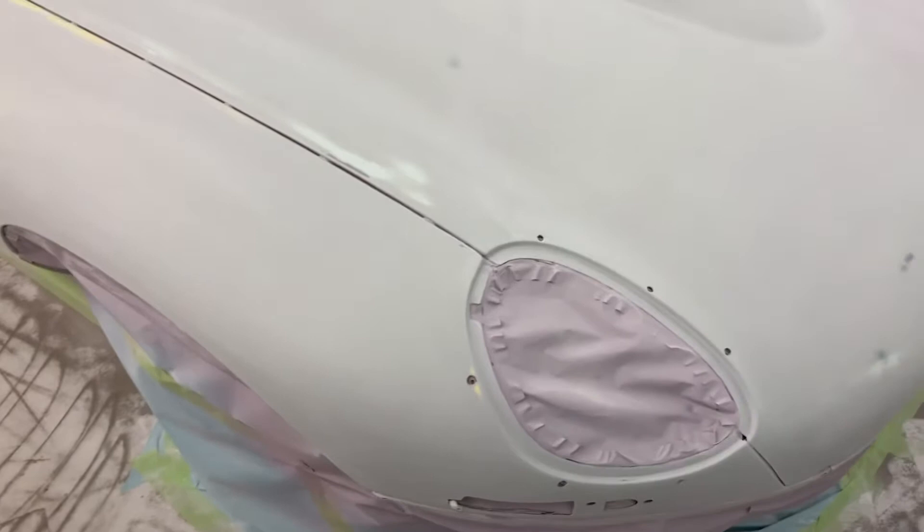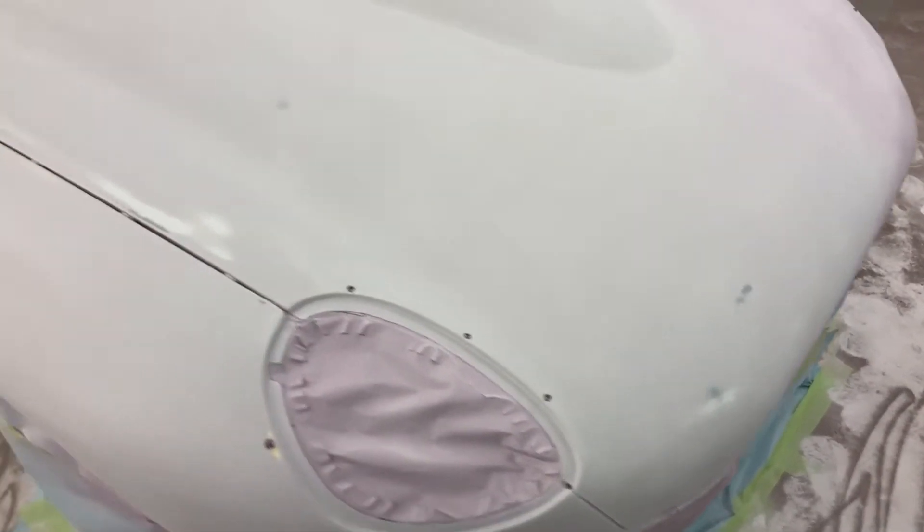So once you start hitting metal, you stop obviously. Keep sanding and you're not really doing anything but making more of a mess. And when you spray these high build polyester primers, you gotta make sure how you spray it. You gotta spray it really even — if not, you can make your body work look bad. You'll have lumps in it if it's not sprayed even. So it's twice the work when you're block sanding.